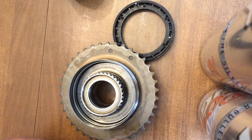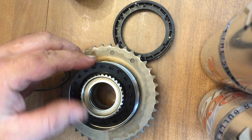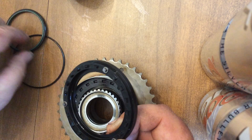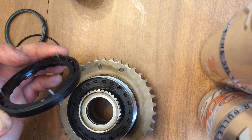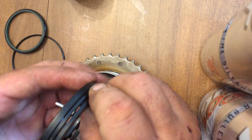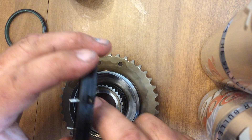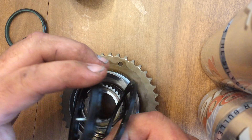Then what you have is your plastic O-ring and seal parts. Drop the first one in there, and you can see here are the pins that they use for testing if your piston is getting fully retracted to its retard position. Basically, this piston down here will contact the pin there, you put your ohm meter on there to see if you have connection — continuity to the Vanos gear. It tells you if you're in the fully retracted or retarded position.